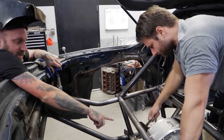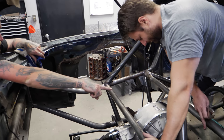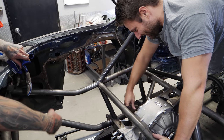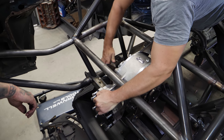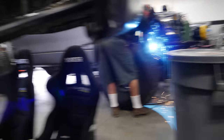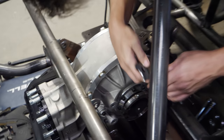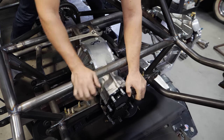So you pull these two brackets off completely, those come off, that top tube comes out completely, and then it'll fall over and roll right out the front. You could pick it up and wiggle it a little bit. I'm thinking I'll have a jack underneath it when I go to remove it normally — do it on the ground. She's out.